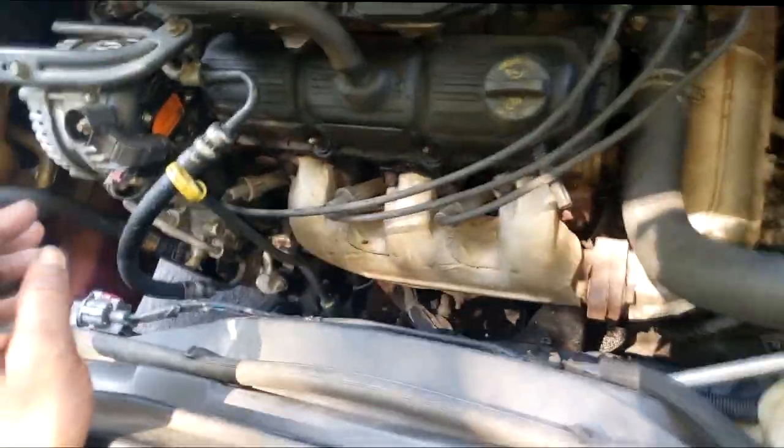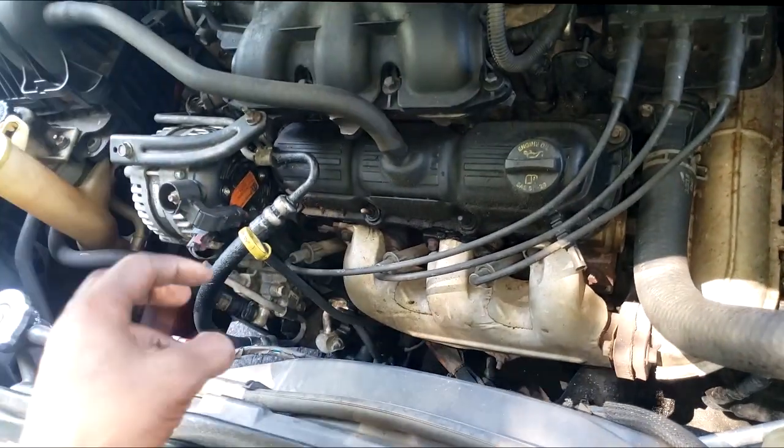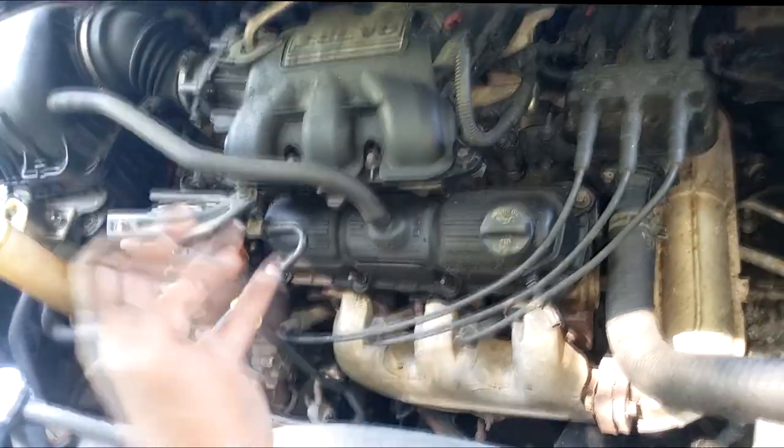I'm gonna close this video when that line gets here. Guys, it's pretty straightforward. I'm gonna reclaim any remaining Freon, take the hose off, put a new one on, and repeat the process of the AC system service.